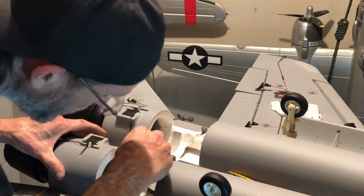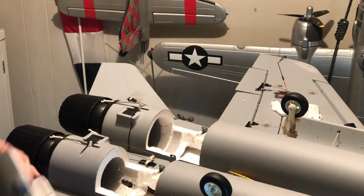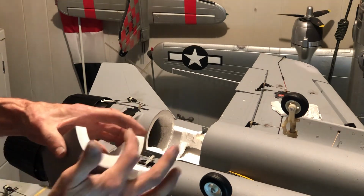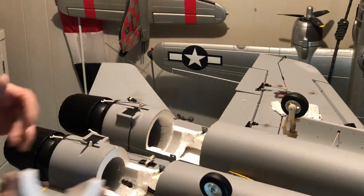Now on the cover that goes over, don't do no cutting on that, nothing at all, because on the back cover you want this wall here to cover the edge of the burner, the ring burner, so that there's no flow disturbance.